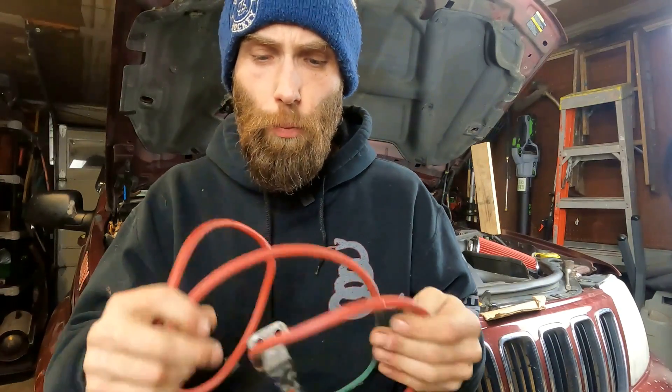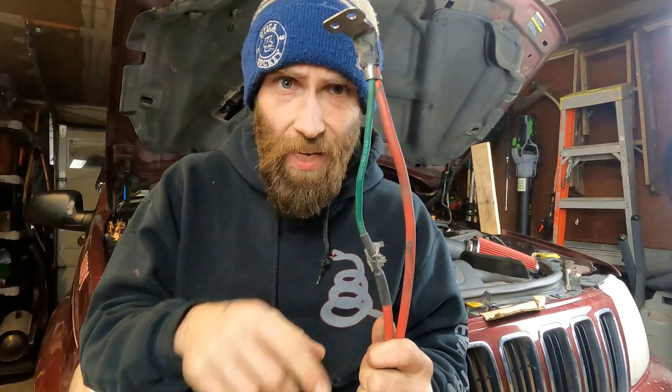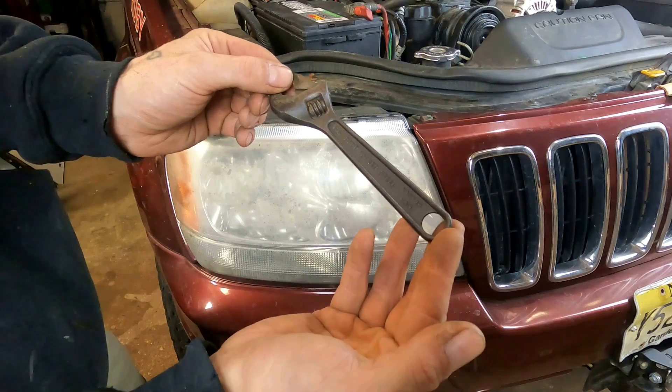What I have here is the alternator-to-power-distribution-to-battery cable from a different WJ from a junkyard — I pulled this when I was at Vince's U-Pull in Marcy, New York. You can get just the fusible links, and that's how most people fix these, but I needed to replace my battery cable anyway, so I figured why not just grab the whole thing and then I have a factory-connected fusible link right there. Long story short, if you're here about WJ fusible links, this is where you find it — it's green, it's 10 gauge, it's kind of a big fusible link behind your passenger side headlight.